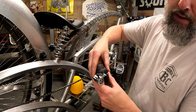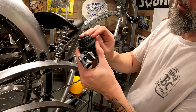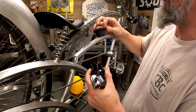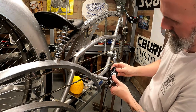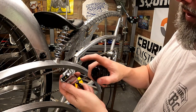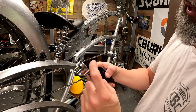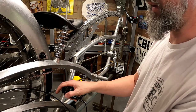I think our next step is going to be installing the shifter. I'm not going to completely install it because I'm going to have to wait till everything's done and powder coated for final assembly before I run the cable back up through here. I did do a full video on how to install a suicide shifter on these Nexus hubs — you always remove the rubber piece here, try not to break it. This is going to go on almost upside down. Always put it in second gear before you take this stuff apart.